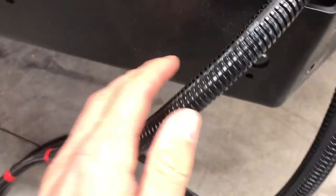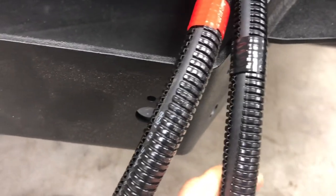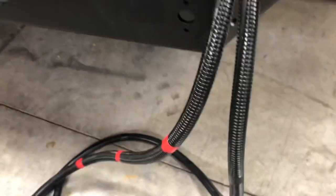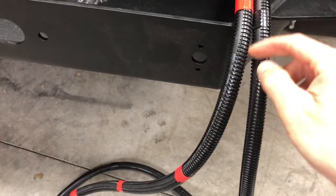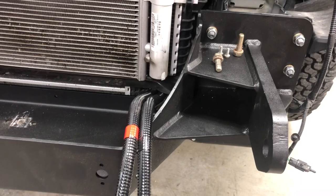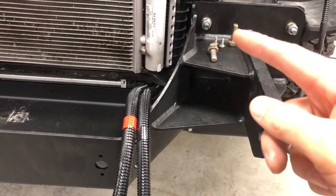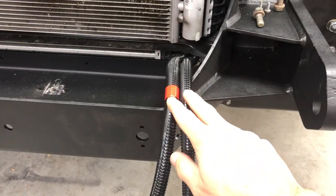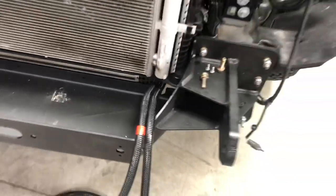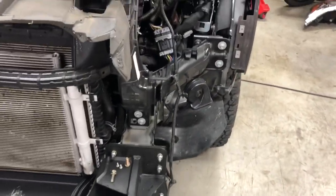I used half-inch plastic protective wire loom from Amazon. As you can see right here, it doesn't quite cover it all the way — the half-inch is not quite big enough for the two-gauge cable. Any place it might contact metal I might double this stuff up, or over the engine mounts and frame I'm going to take an old piece of rubber hose or radiator hose or clear tubing, wrap it around both cables together, tape or zip-tie it up, and then zip-tie it to the frame all the way back. I'll try to take you underneath the van to show you what I had to do to get it up through into the battery box.